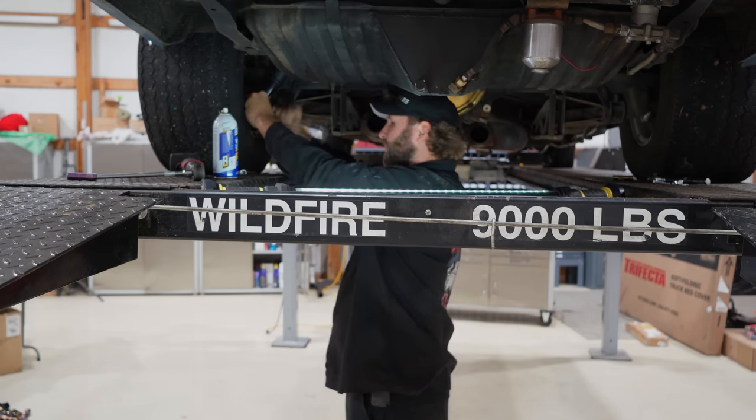He's strapping her in. We're also setting air pressure. We're gonna run the tires a little bit higher. We don't want any squish on the rollers, so we're probably gonna run those about 30 pounds or so, and do a couple light pulls, just check everything over, make sure it's safe, make sure the engine's happy, make sure it's in the rollers nice, make sure there's no weird driveshaft vibrations or anything like that, and then we can start stepping it up a little bit.